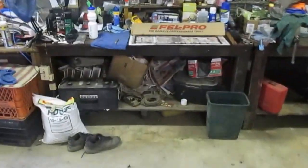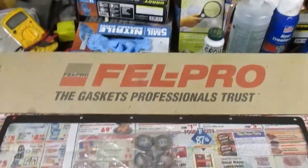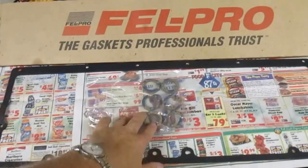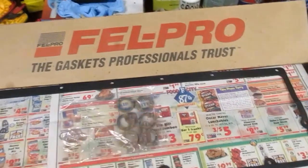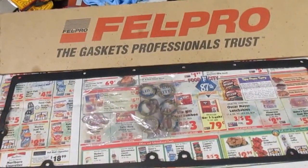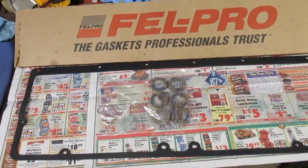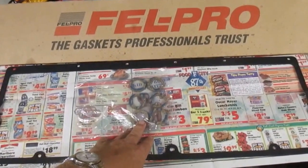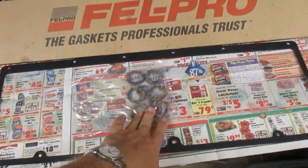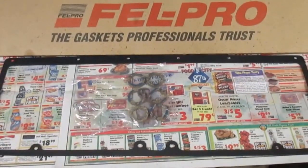One thing that you have to keep in mind when you replace these gaskets on the 216s is you've got these six cork gaskets that go around the plug openings, and that seals that to keep oil from getting into the plugs or around the plugs and possibly causing a short or a leak anyway. So you need to put some sort of sealer on that will hold those on. Same for this gasket while you maneuver that big pan in place.